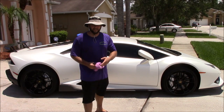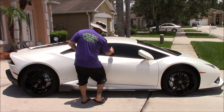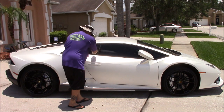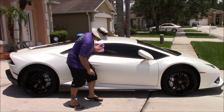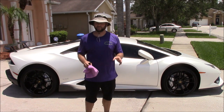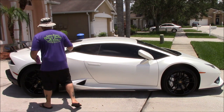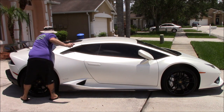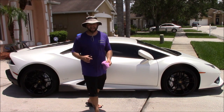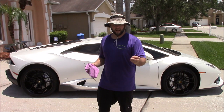Now that I've got all the paint coated with Force Field Matte, I'm going to use Infinite Force Field on the glass. Generally, I recommend applying Infinite Force Field with a dual action polisher and an applicator pad. But on glass, if you're careful, you can do it by hand — no problem. You definitely want to work fast so the product doesn't dry prematurely. If you work fast and efficient, just spread it evenly, let it cure for an hour, and you're good to go.